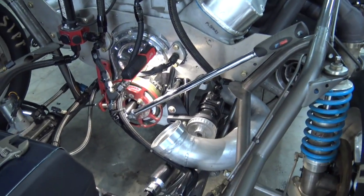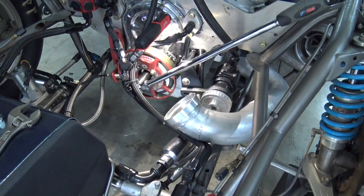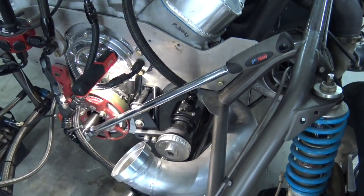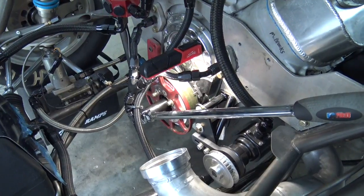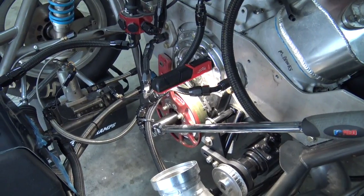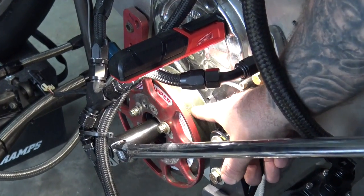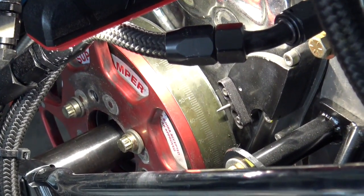You're probably thinking it's not prior because we went 195. But remember, this is before top dead center. The key is that there's a compression stroke and an exhaust stroke in an engine. A lot of you guys seem to screw this up. The compression stroke means it's making compression, and the exhaust stroke means we've got exhaust. The cam spins at half the speed of the crankshaft, so 60 degrees here can be on the compression or the exhaust stroke. We want to do everything on the compression stroke.